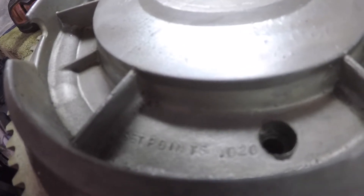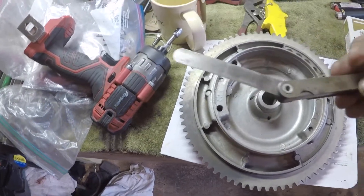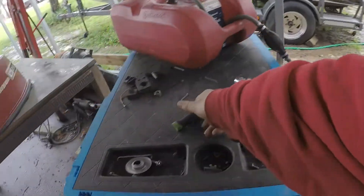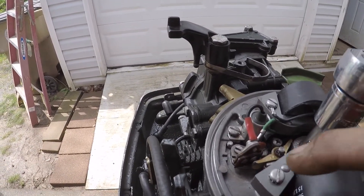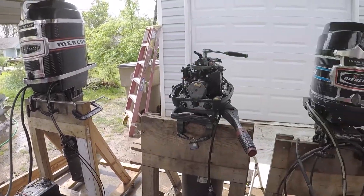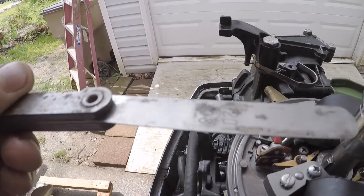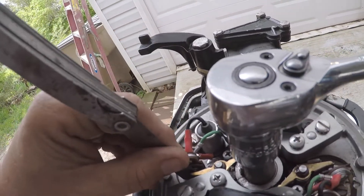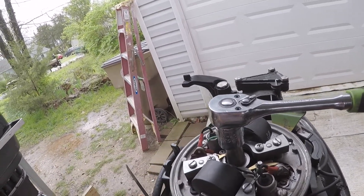Set points to 0.020. No magnet on this side — it's only on this side we've got a good magnet. We're at 0.020. Just open these points up by taking something like a wrench and then rotate it around. Those points are open — now clean it and take a little piece of paper and just slide it between the points to clean them. I got my feeler gauge; this is an old one so the numbers won't come off very good, but 0.020. It's actually pretty good, so I'm not even gonna adjust it because it's there.